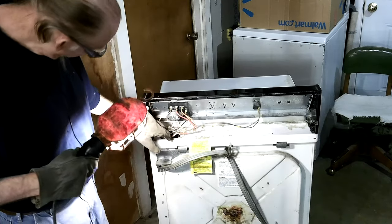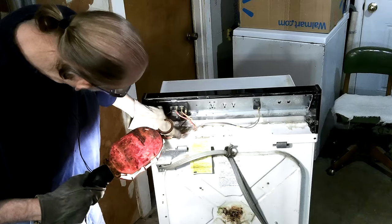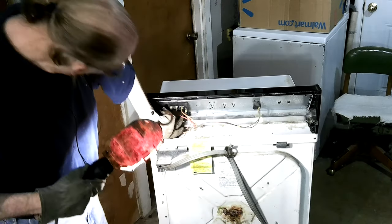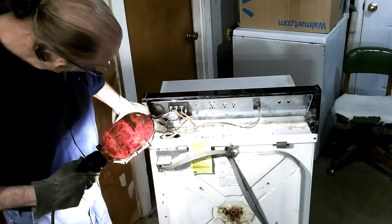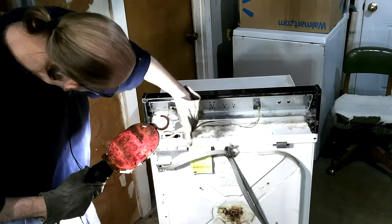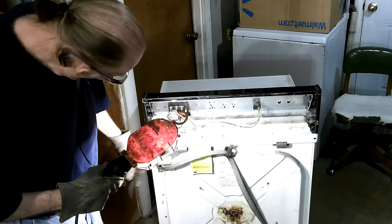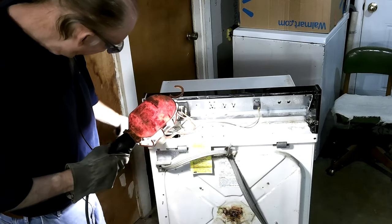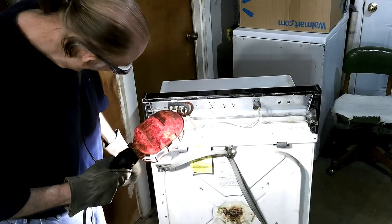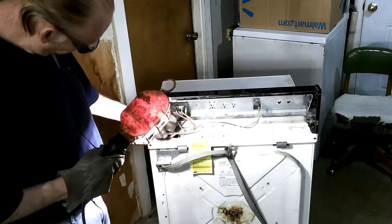And some kind of a jumper. Well, it's not a jumper. It's going from here to... it's for the motor, yeah. This is the timer motor. I know that. Oh, and that one goes to its own connector. This other one has its own... there's another black I didn't see. Two black ones going to the motor. They're both black, but one's going to be the power and one's going to be the ground, I'm sure. Unless it grounds by its case. And it could be switch wires. Probably it's a switch wire, and then it grounds by its own case to the switch.